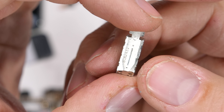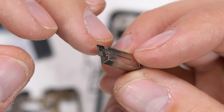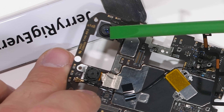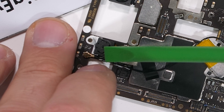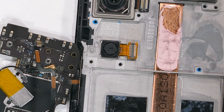The under-screen earpiece is an oversized tic-tac looking block that vibrates the display to transmit its sound to your ear. And then of course we have the four rear cameras: the top 8 megapixel wide angle camera, the large 64 megapixel main sensor, the 2 megapixel depth camera, and the 2 megapixel macro camera — none of which have optical image stabilization.